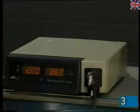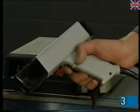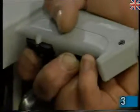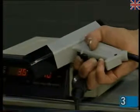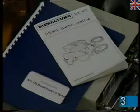Corrections to the timing are, as usual, made by moving the pump. For checking vehicles that are not fitted with a flywheel sensor, a timing light is provided. The light is switched on by pressing the lower button, while operating the upper switch will appear to move the timing marks relative to one another. Press the switch until the reference mark and the TDC mark are aligned. The actual dynamic timing figure will now be displayed in the window and can be compared with the specifications. For a more detailed explanation consult the literature provided with the equipment.